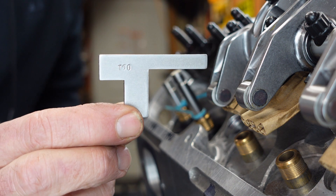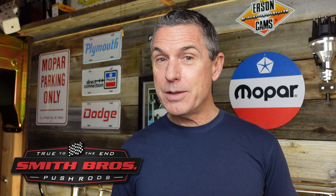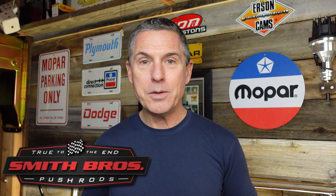What we're going to do this week is I'm going to show you how I measure the stand height for the T&D rockers. It's super simple — they provide a little tool that we use. We're going to check that just to make sure it's right. And then we're going to measure the engine for pushrods — we're going to measure the radiuses in both the rocker arm and the lifter, and also measure the overall length of the pushrod so that we can get those parts ordered. I use Smith Brothers pushrods in my engines, and one of the reasons why is because they're right here on the west coast up in Redmond, Oregon. Normally when you call those guys, your pushrods are getting made the next day.